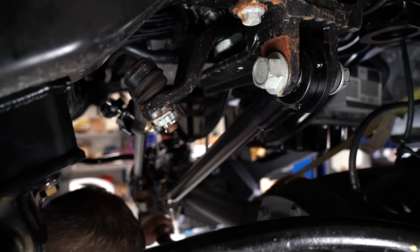Aren't we trying to upgrade the truck as we're putting new parts on? An OEM bushing is typically just like a melted in, pounded in Cleveite bushing, and those really don't last long. The Carli track bar uses Made in America FK rod ends as well as uniballs, and it also has a geometry correction built in, so as we lift the truck, the pivot point of the track bar shifts just slightly.